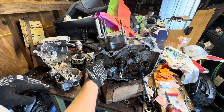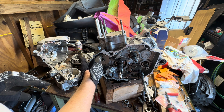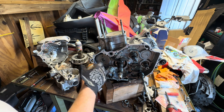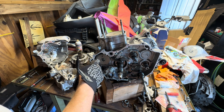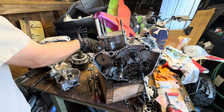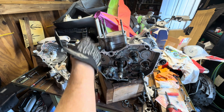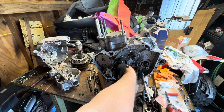Earlier when I first put the engine together I was one tooth off — it was like on a clock, about 30 minutes or one hour off. But now we know we've got it exact. If we go over here to the timing mark, the timing mark lines up with the T. We want to rotate it again just to verify.